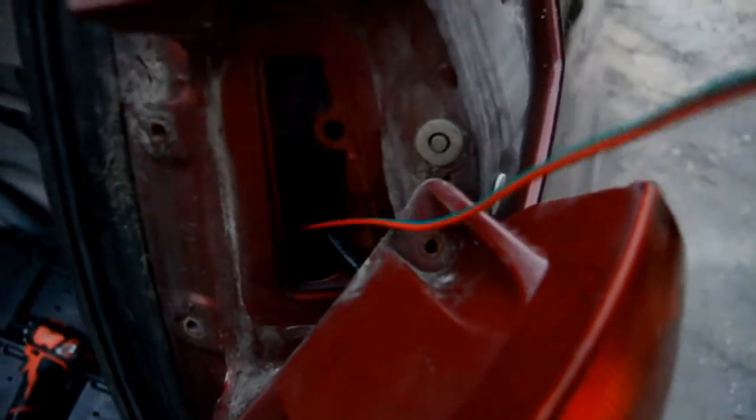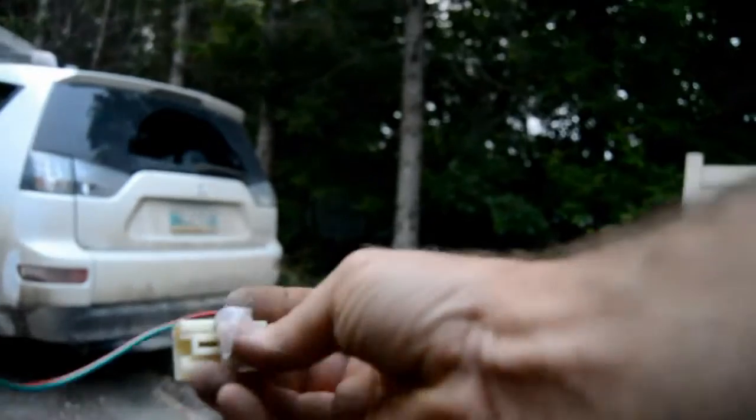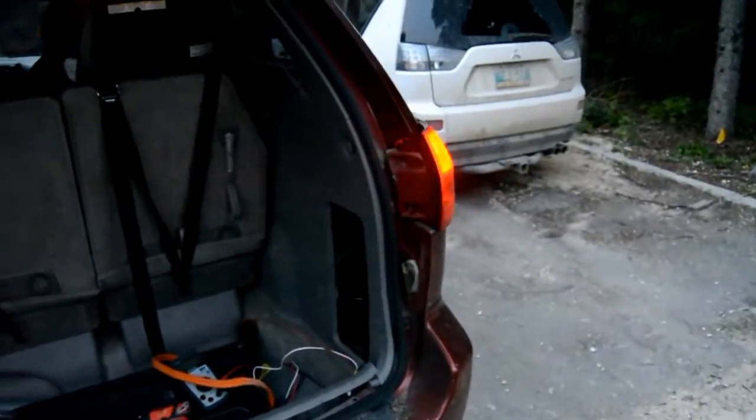There we have it — out like this. Now the same thing: we're going to carefully disconnect this clip, clip this in like this, this can go back in, and now this becomes our new lead for the tail light. I'm now just going to do a quick test to make sure that I have power and that my lights are working.